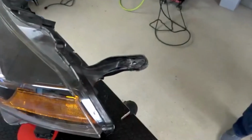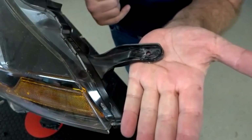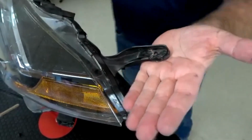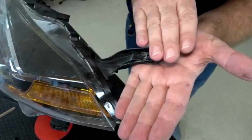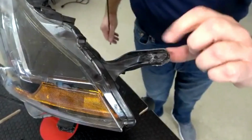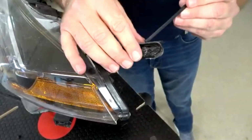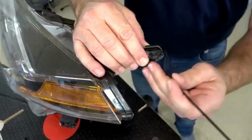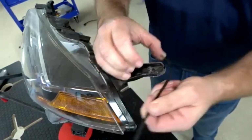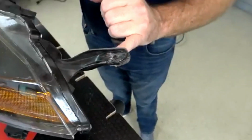So we recreated that from scratch. We grooved it, prepped it properly, and applied a piece of aluminum tape as a platform to support it. And we just filled this in and built it up with welding rod and got our platform tab, if you will, there. And then to get this little lip on this outside edge, we used the 07 welding rod and wrapped it around this edge. We just welded it right around and made that lip on the edge right there. Okay, great. That was the actual end of the tab that was missing, so you recreated it from scratch.